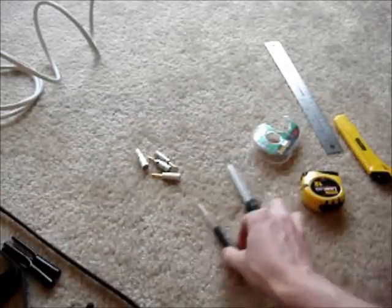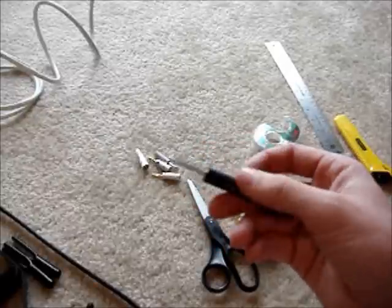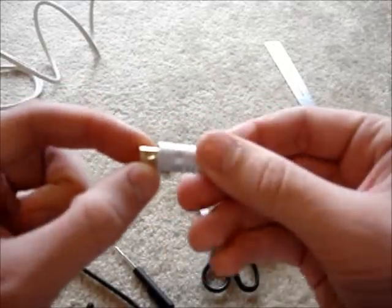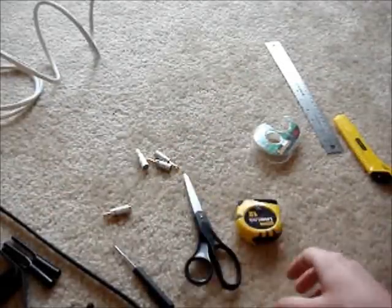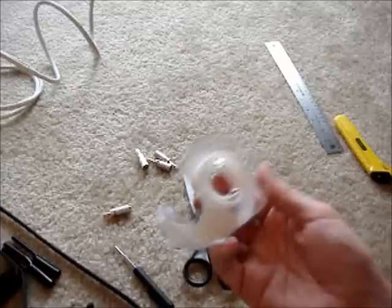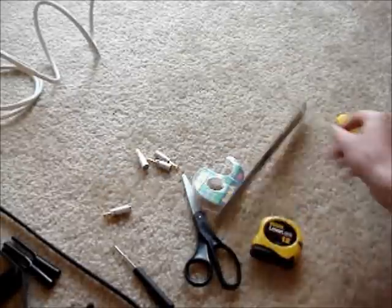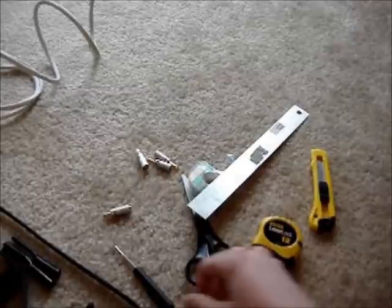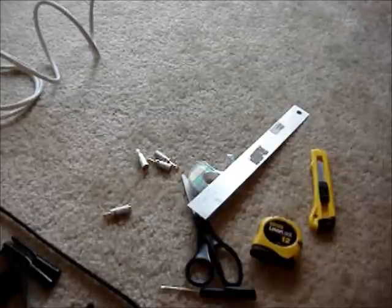As far as tools, just some basic tools you probably have laying around. Depending on what type of connector you use, you're going to need a screwdriver — the GLS plugs actually come with one that has a flat edge and a Phillips head. You're going to need scissors to cut your cable, a measuring tape to measure out the sleeving and cable, some scotch tape (I'll explain why later), a ruler for measuring the amount of cable to strip, a razor blade to strip the cable, and either a heat gun, a hair dryer, or a lighter. We're going to be using a lighter today.